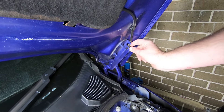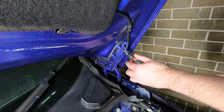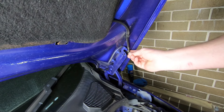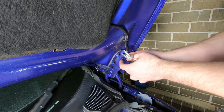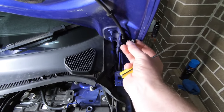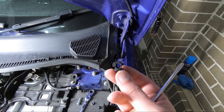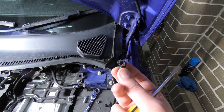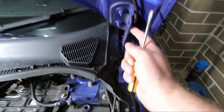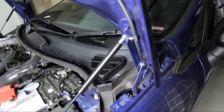Now we're going to remove the clip that holds the hose for the windscreen washers. If you have a close look, it's just a circular plug with two little prongs that spring out — get a grip on it with some pliers, squeeze them, and pull it through. I've ended up taking this hose locator off because it was getting in the way of the nut and the bolt. Just get a flathead screwdriver in there and pry it open, and the hose comes free. It actually comes with a little self-adhesive strip.